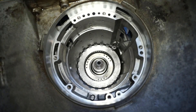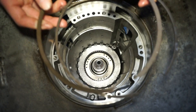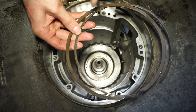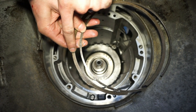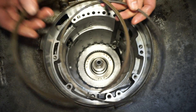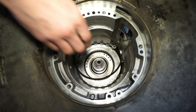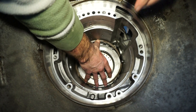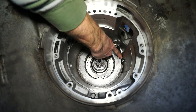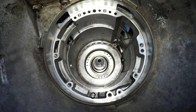Now we have our intermediate snap ring. I have two snap rings here — this is the factory snap ring, and this is the HD2 kit intermediate ring that comes with the kit. You can see there's quite a big difference — the HD2 kit ring is a lot stronger. So I'm going to toss the factory one aside and put this beefcake HD2 kit snap ring in there. This one is going to go in with the opening at the nine o'clock position, just like all the other ones — all three snap rings get placed with the opening at the nine o'clock position.